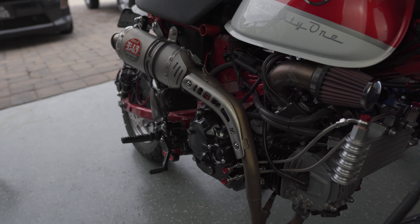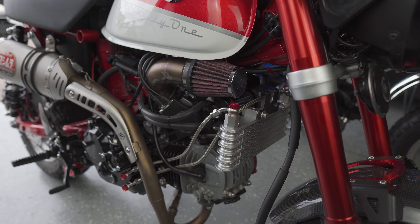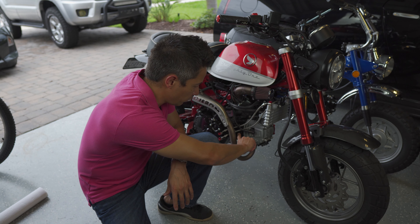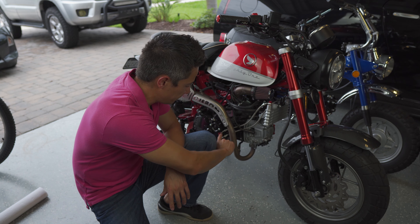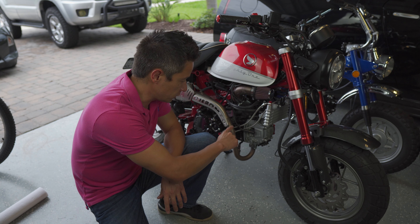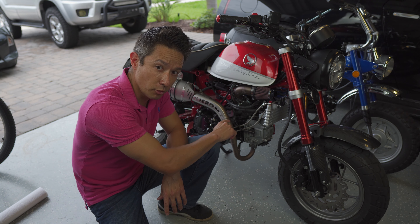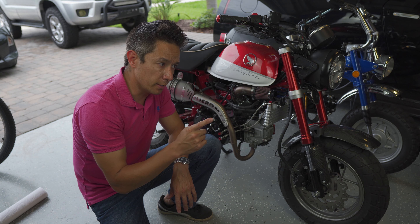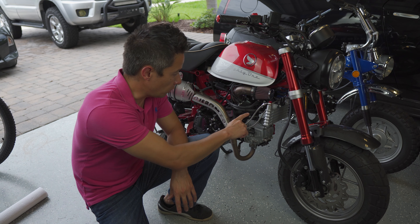It was used, a good deal, and I just fashioned my own bracket to mount it somewhere right about there. It really fills out the leftover space between the radiator and the intake and I think it looks pretty good. I'm going to work on this mount, fashioning it so I can mount it up to the bracket up here, then connecting all the tubes. I believe one line goes back into the oil filler, one goes to the crankcase breather, and the other is just a filter — though I'll need to clean it out since it's so saturated in oil.